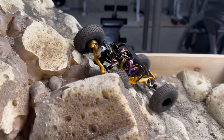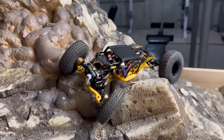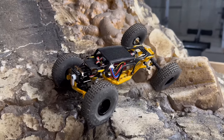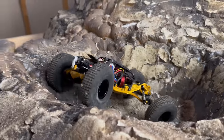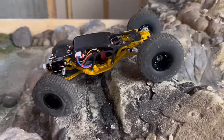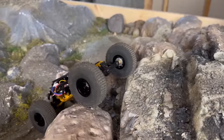So it's interesting. I'm getting quite a bit of heat out of the Python, but very little heat out of the motor. The cedar motor itself still feels very cool to the touch, hardly even warm. But I can feel through the roof that the Python's heating up. So I might want to turn that voltage down. No running issues at all, and it's not like hot, but it's definitely putting out some heat.